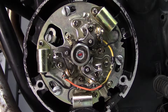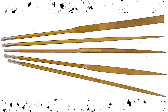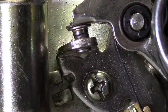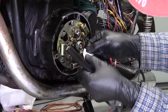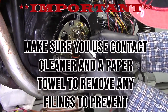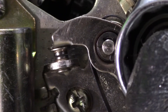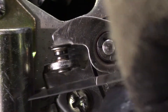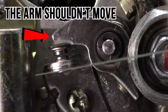As you inspect the points, check the contact surface for pitting or uneven wear. Minor imperfections can be corrected with a diamond grip file. Be mindful to file the contacts flat — uneven facing will result in improper contact. These points are actually in really good shape, so to get them ready for service, all I'm going to do is clean the faces of the points with a light scuff from some 400 grit sandpaper. An easy way to do this is to close the points on the paper and give a little pull. To check the gap, all you have to do is rotate the engine to where the points reach their largest gap. Once you've found it, check it with a feeler gauge. You'll know it's just right when you feel a little bit of resistance but the feeler moves freely, or you can get a size outside of spec and make sure that it doesn't fit.